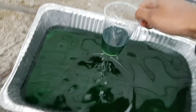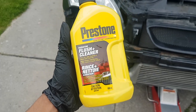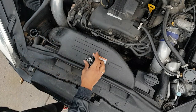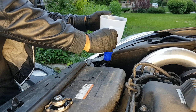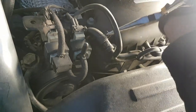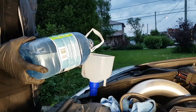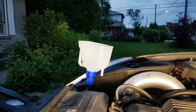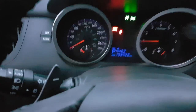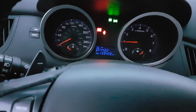Let's take a sample of our original coolant and save that for later for a comparison. In this step, we're going to flush our system. Depending on how bad your coolant system is, you may want to use something like this. Open up your radiator cap to start filling in with distilled water — make sure you don't dump it in too fast or else it may just leak out. If you find your system is backing up a lot, there's a purge line or relief line you can undo. We're going to continue filling up our system. Since more distilled water isn't going through, we're going to start the car and let the pump cycle through the entire engine. Watch your coolant gauge — make sure it does not overheat your engine. Let this cycle through for like 10 minutes or so.